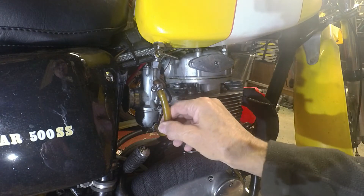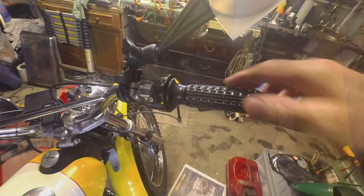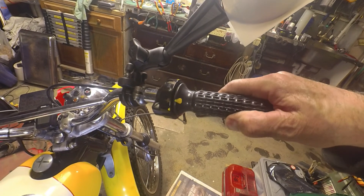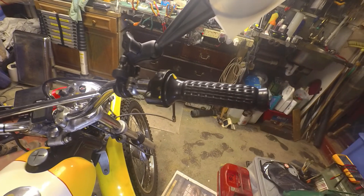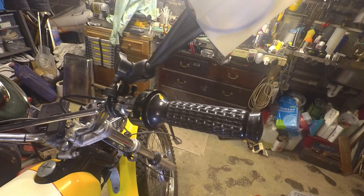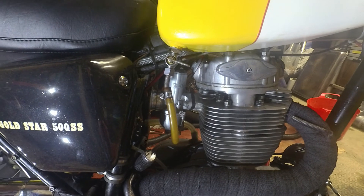Right, so it's all back together. The nuts are tightened up to the correct 10 foot-pound torque, and the slide feels absolutely free — you can hear it just clicking down on the throttle stop. The throttle is still marked up from off to full: half, quarter, three-quarters, so I can get a handle on the tuning, which I think is probably pretty close from the experience so far. I'll check it out again now that the carb has been retweaked. That'll do for now — thanks for watching.